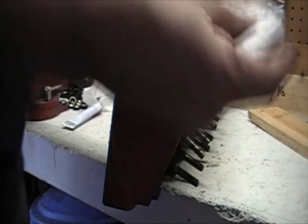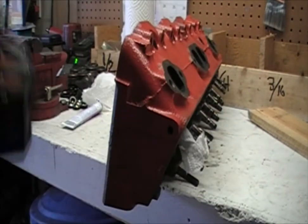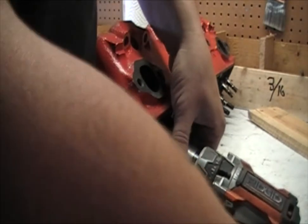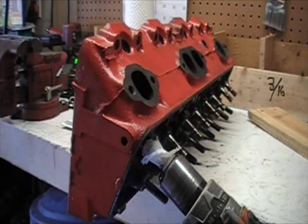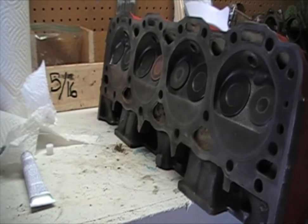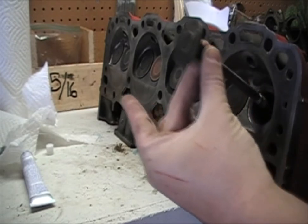My way of doing it is a lot faster. Take a piece of paper towel and wrap it around the valve stem. Then take the drill, open it up all the way, hold this side here and slide it over that, and spin it into the chuck — make sure you don't bend it. Then spin it and lift off, then push it back down and lift off, increasing the rate of speed. After about 10 to 15 seconds, when it starts to get a little quieter, you can stop. The drill slipped off, but that's okay — let's take it out and see what we got.